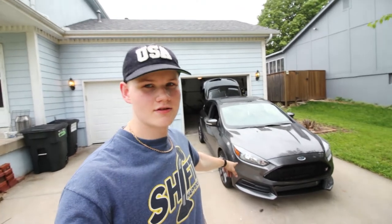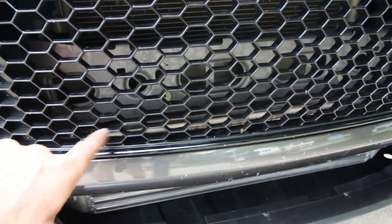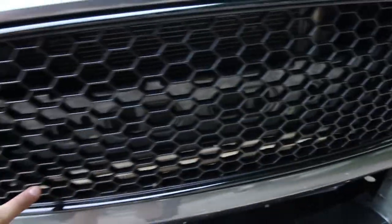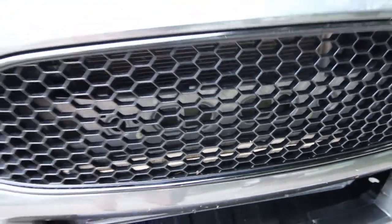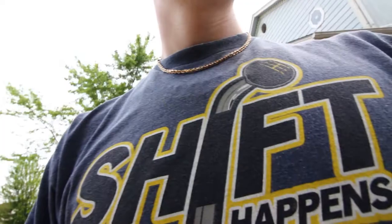We finally have the car all put back together. The intercooler looks super nice and it drives super good with no boost leak. I also did the grill shave, cut out that strip of plastic that went across the bottom, and took off the plastic off the crash bar so it's more open — gonna get some more airflow into the radiator for better coolant temps. We're done with this install. I hope it was helpful for anybody installing an intercooler of any brand — it's pretty similar across brands. Drop a like, comment your thoughts, and subscribe for more videos.